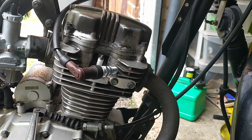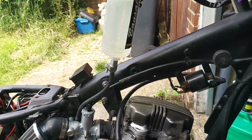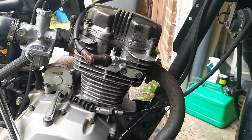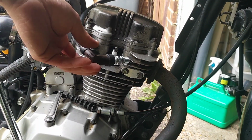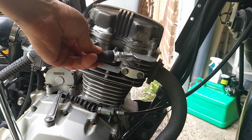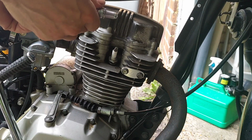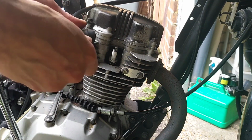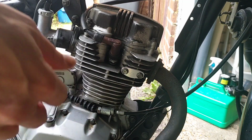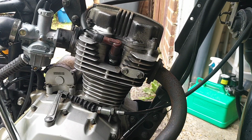Right, tank off, secondary tank on, dummy tank, whatever you want to call it. I realise I'm not being very systematic here. So let's check spark first. I left the main spark in, got another spark there. Nice, strong, booming spark kicking out. Should probably do a compression test, but I can't be bothered at the moment, mostly because I think the seal's gone on my set.